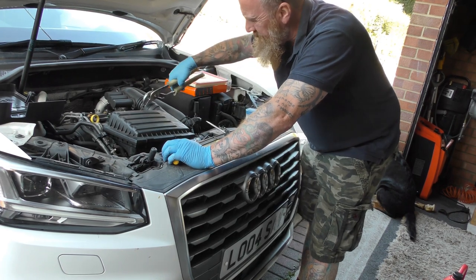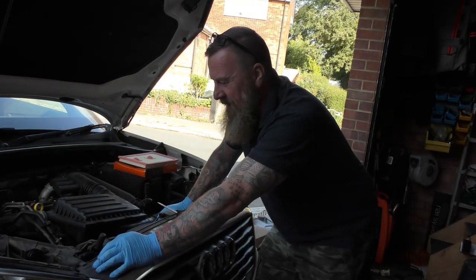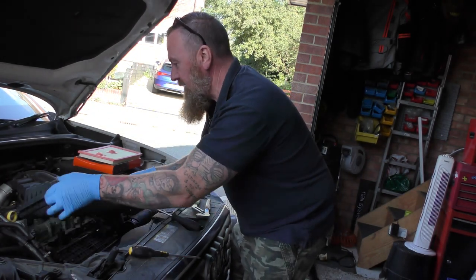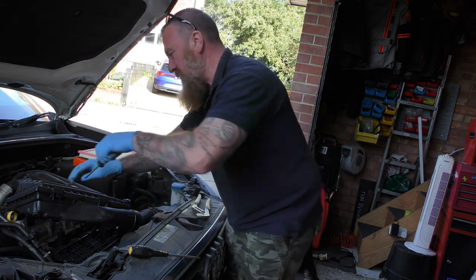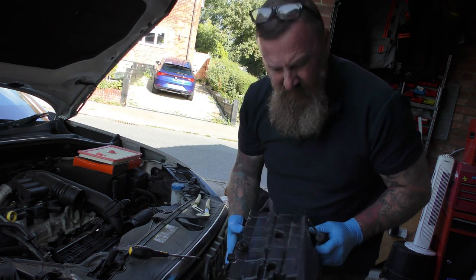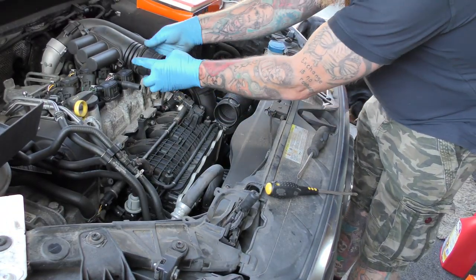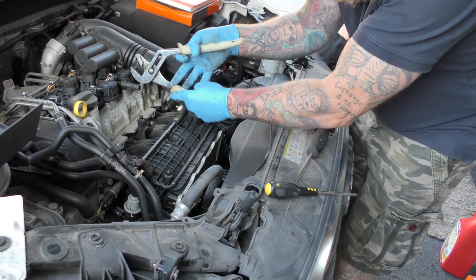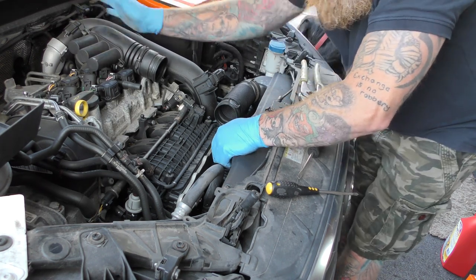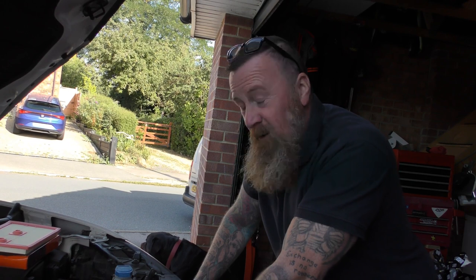It turns out: little clips — pick it up, push that one back. Little clip, push that one back here. And literally it just pops off. A bit strange — you are, to be honest, a little bit scared of doing it because normally they'd be bolted in, wouldn't they? You do feel a little bit scared, yanking something and thinking, well, if I broke it. There is a little pipe here — just a small screwdriver. Yeah, two ordinary Phillips screws. That was easy. Look what I'm talking about — just this one here, lift it, pop it out. This one here, just push it back. Simple. Just get hold of them, clip them, push them back. One little air pipe — that's it. I did find where the spark plugs go — here. Looks like that's got to come off as well, somehow. Oh, there's another clip there that comes off, and the spark plugs are here. They are just a 10mm bolt that holds them down — there are four there.